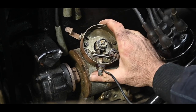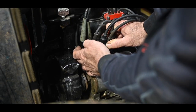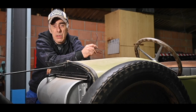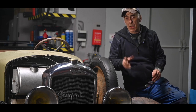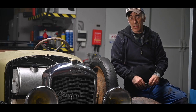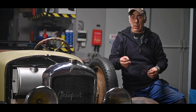Have a look here — see how that moves. I don't know if you saw it but I saw some sparks, very faint. I have some bad news. I've been trying to crank up the engine a couple of times and I almost have no arms left. The magneto is just not doing what it's supposed to do. The sparks I see on the magneto are way too faint, and that's because of the magnet — the permanent magnet inside the magneto has lost its magnetism.